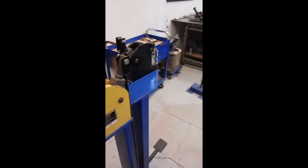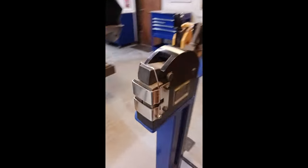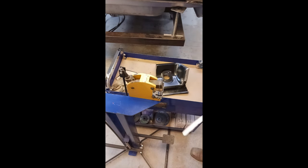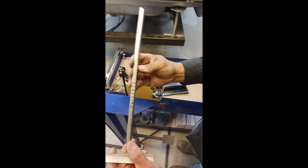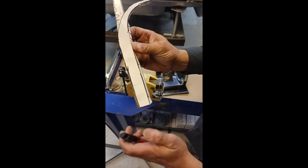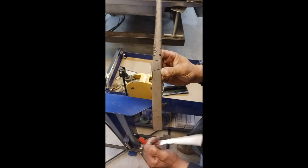To accomplish this we're going to use a shrinker stretcher. This is a foot-operated machine. We work this machine by depressing the foot pedal, which pulls down on a rod, and inside there are four separate jaws that either push together or pull apart — they squeeze together first, then push or pull. We never use oil or add any type of lubricant in that. Let's make some magic — this machine is so cool. Now that's the shape we're going to bend, and we'll get a rough idea and put some marks on where we're going to start the bends.